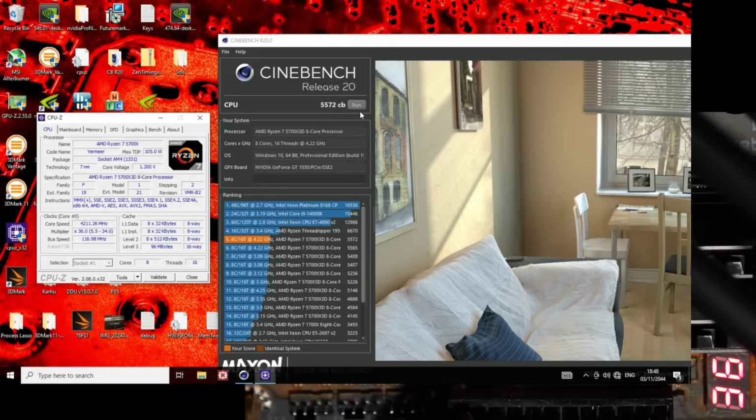What I'm most interested in trying with this CPU is an X470 or an X370 motherboard, because on those boards you can actually get an external clock gen, and the built-in clock gen of Ryzen CPUs only goes to like 119 megahertz. So we're kind of limited on frequency in terms of that. Though, funnily enough, the CPU already seems to be running into a core voltage limitation.